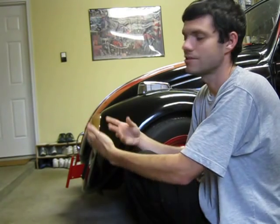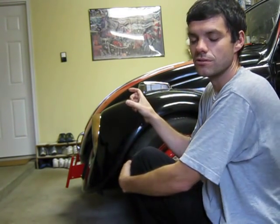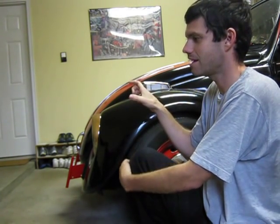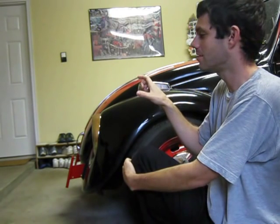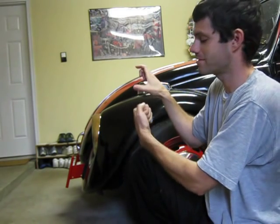What I think happened when this engine broke was the valve spring broke, and then the spring retainer fell off. And when the valve spring initially broke, the push rod and rocker were still attached. So this was happening while the engine was still running. The valve was opening, but there were no springs or anything to close the valve or control how far it fell into the combustion chamber when it opened. So this valve with the broken spring was hanging way in the combustion chamber.